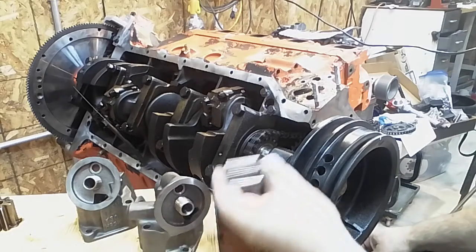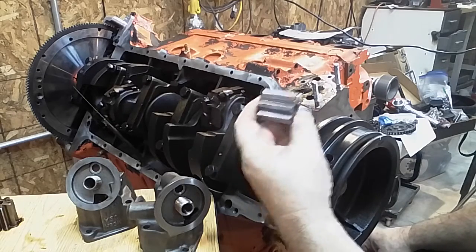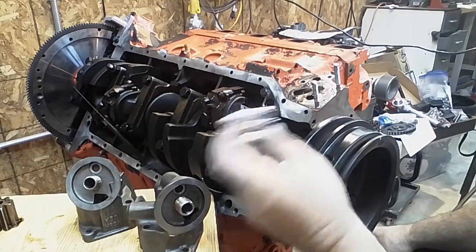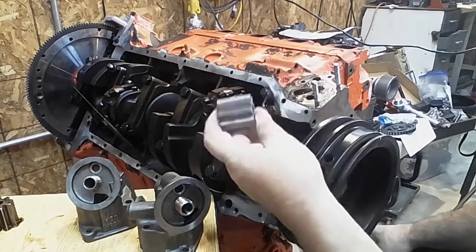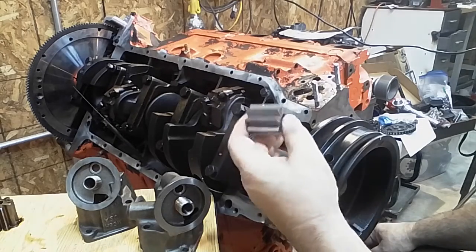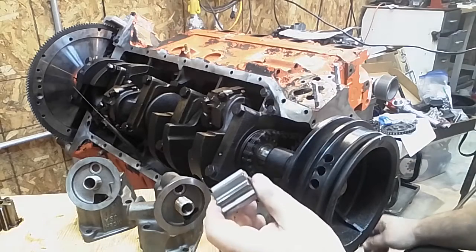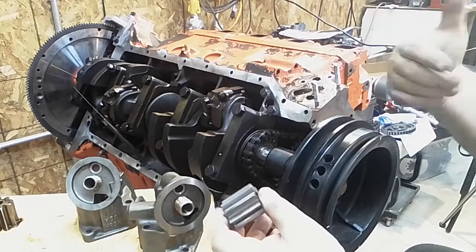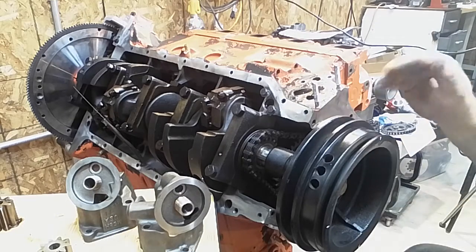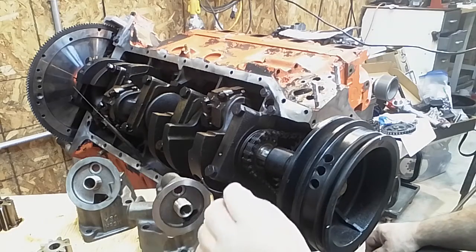I mean, the real problem is we don't have a high volume pump. The gear is the same in every single pump. You can swap the gears. They sell just gear replacements because the gears are the same in all the pumps. And because the gear is the same, that's actually what sets the volume for the pump. So unless you go to an external belt-driven mounted pump of some sort, you really can't change how much oil you're going to move with any given pump.